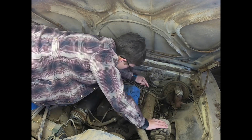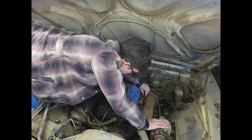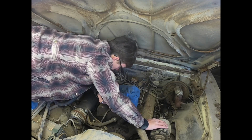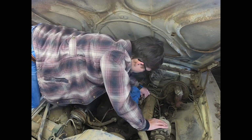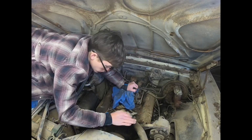Oh, I think it's a Turbo Hydramatic 350 because I think they use linkage to shift, and then the 400 uses vacuum, so I think that linkage right there off the carburetor is the transmission shift control.